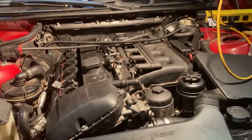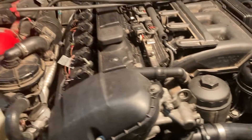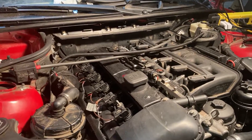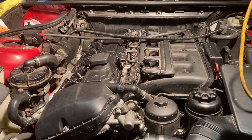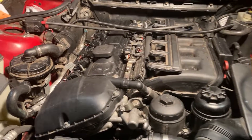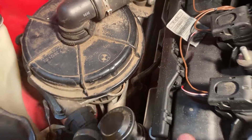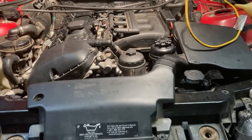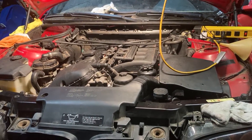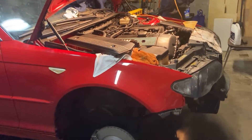We ran the engine for a little bit and topped off some coolant. After idling for a while, that lifter noise is pretty much gone, the coolant fans kicked on, and it's running much better now. We still have a lean code for Bank 2, so it could be something with the O2 sensors — not sure if it's damaged or something. My buddy still has some work to do to get it driving again and fix that issue, be it a vacuum leak, bad injector, or sensor. But for now, my job is done. Thanks for watching, and feel free to like and subscribe.